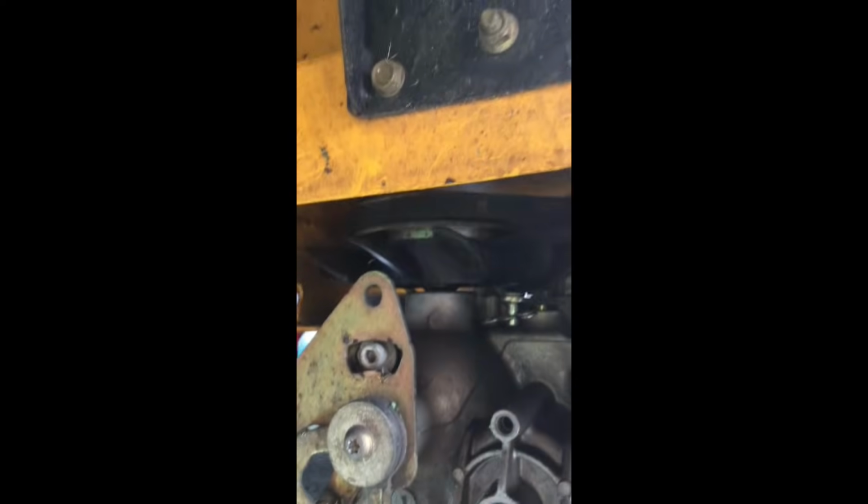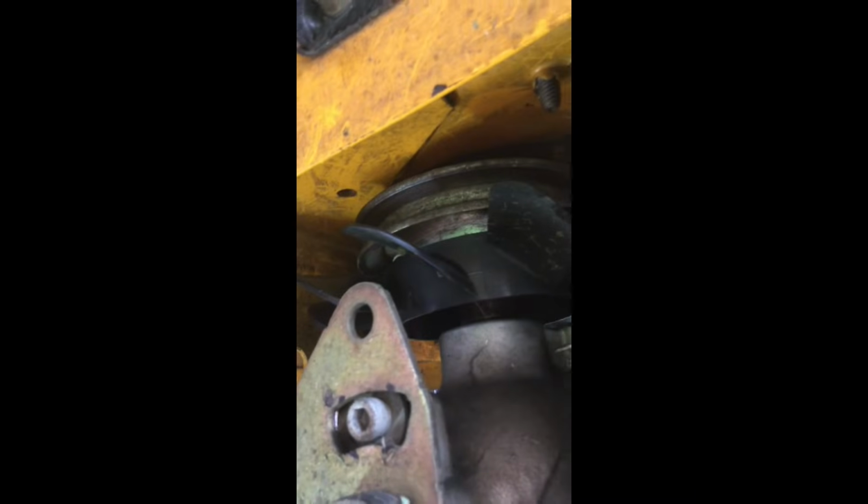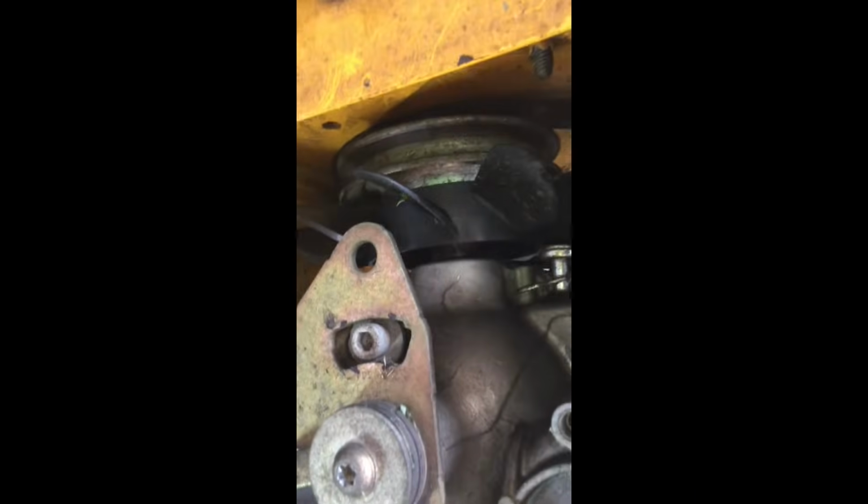All right, now that the axle rods are off, next thing you need to do is remove the drive belt. Right there, not very difficult. You want to loosen tension with the spring already removed there. Loosen tension on this pulley here. Just kind of pull it back. And then this right here, basically you can just slip it off and over top of the pulley. You just need to make sure you get that drive belt off before you begin to remove the actual transmission